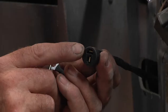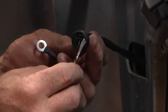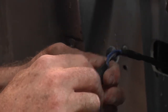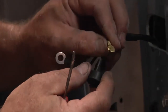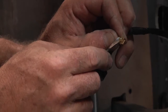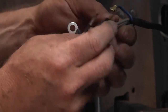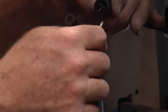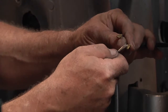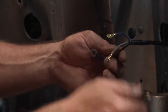Use a small flat blade screwdriver to remove the plug. Remember which wire is on top and which is on the bottom. Insert the flat blade screwdriver on the small side of the plug — not the large opening, the small one. Slide it in, give it a little tight squeeze, pry down, and that wire slides right out. There's a little tab on the bottom — that's the keeper lever. You've already pushed it down to get it out; now pry that tab back up a little bit. Same thing on the second wire — go in the small opening, push down, and it slides right out. On the left side, blue is on top and gray is on the bottom.